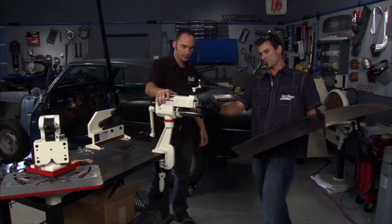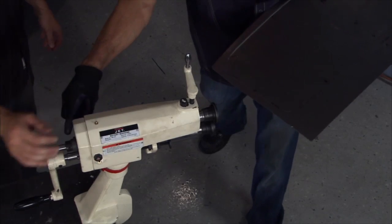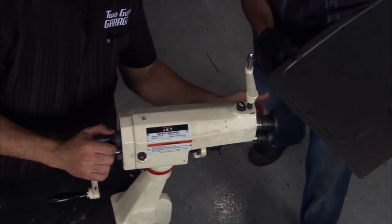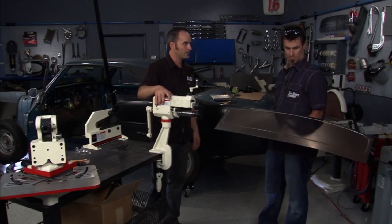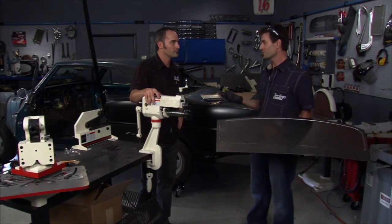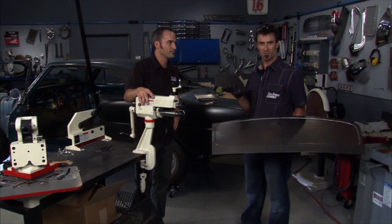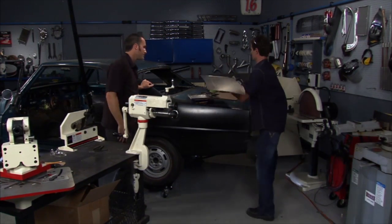When you set your bead roller up, there's a little adjustment in back to control the depth of bead, thickness of panel, and how aggressive you want to get. These beads make it look a lot more professional and give it strength. You spend a lot of time and work on these things — you may as well make it look cool. We've got one more panel to bead, then it goes back in and gets plug welded all the way around the edges.